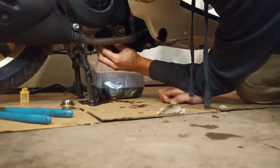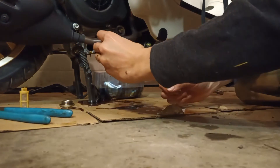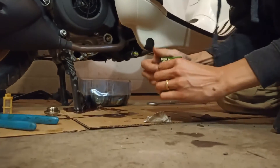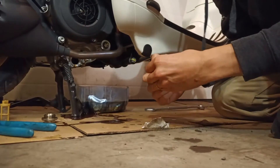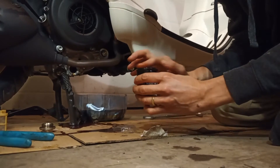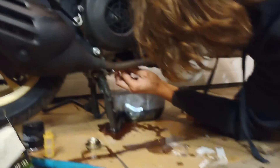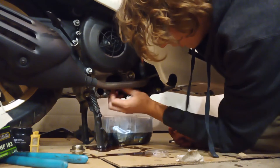Obviously Piaggio makes a filter too. When you install the new filter, you've got to make sure that the O-ring on it is lubed. Most of these come pre-lubed — yeah, this one is. But if it's not, just dunk your finger in some oil and spread it around on that seal, which makes it easier to get off next time and seals a little better. I'm sticking on the HF183.